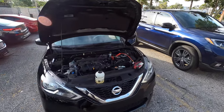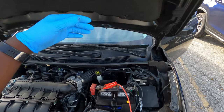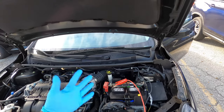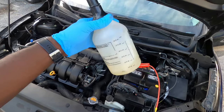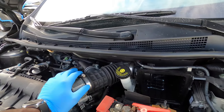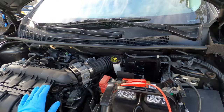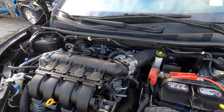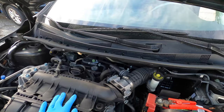Welcome back to the channel. Today we're doing a new video on this Nissan Sentra. The customer complained that they think it's the gas pump because the car was driving and then it just shut off like it ran out of gas. What I did based on what the customer said — I got some gas and sprayed it into the intake right here, and then the car cranked up. If you can get some gas and have somebody crank the car, or even let the car crank itself, spray gas right here and if it cranks up you know your sparks and everything is good — it's just not getting any fuel.